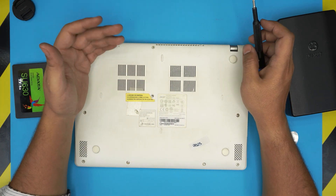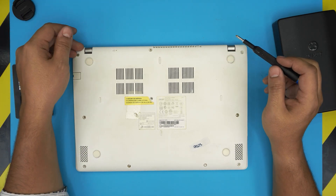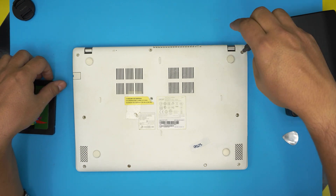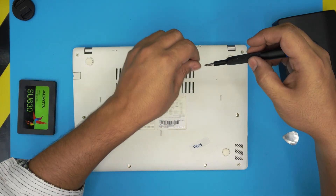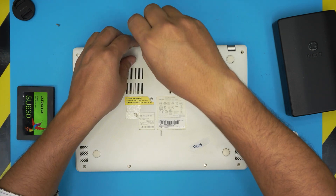You need to power off the laptop completely and back up your files to an external hard drive or somewhere safe. Then on the bottom cover you're going to see a bunch of screws — start from one corner and remove them all. All the screws are the same size and height, so don't worry about mismatching them.